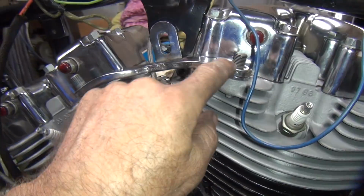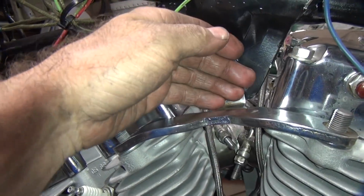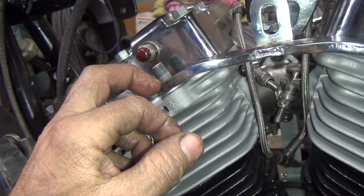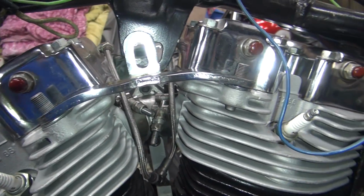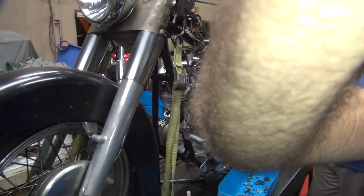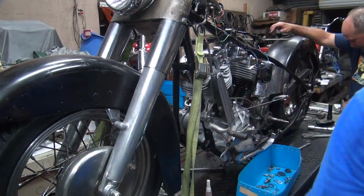Really? It's like an hour. In the real world, we bent this at 22 and a half degrees from here each way, and then we bent this back this way, and we took the twist out so it was equal. So now when you tighten the nut here, this then stays down. You tighten this nut, this one stays down, and you shove it all the way in, it hits against the frame equally. So yeah, we had to modify it a little bit. And this is some nice thick material, so it takes a little pressure, which is good. Beating. That means it'll hold the bike, the motor nice and square while beating the tar out of it. That would be a good thing.